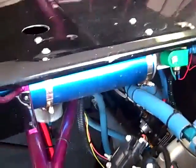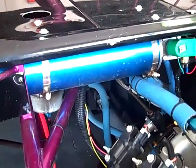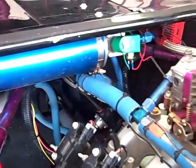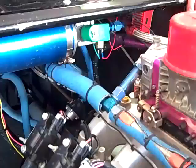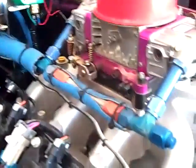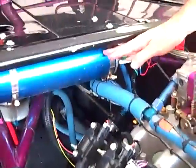And so the AccuSump is something that they came out with years ago whenever there were IMCA motors being claimed for $300, and you didn't really want to put a $500 nice pan on a motor that you could lose for $300 for the whole motor. So people were putting $70 pans on their IMCA motors and then putting this AccuSump, which back then had a hand valve on it. This one's electric.